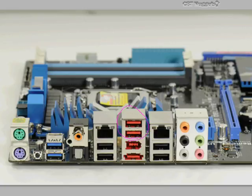Also, we didn't talk about it a lot, but over here, this is something that we're starting to see less and less of these days. But here's a PS2 port for the mouse. The mouse is always green, and this is the PS2 port for the keyboard, and the keyboard is always purple. And you can see here that there are 6-pin connectors in there.